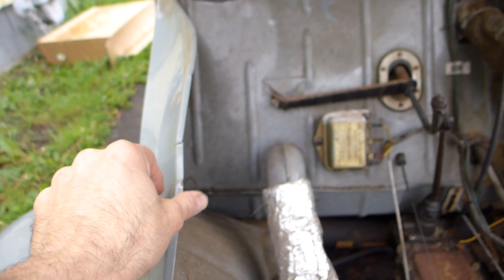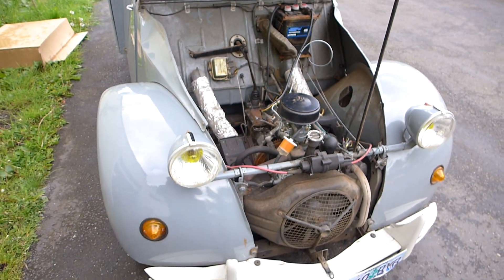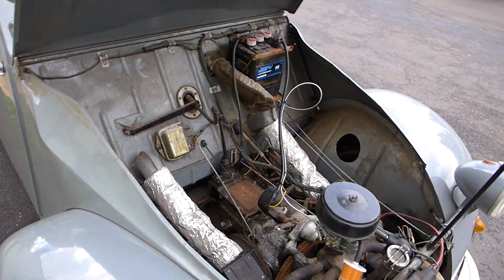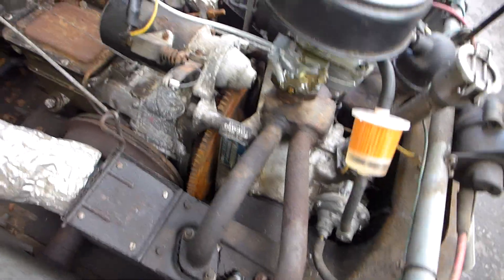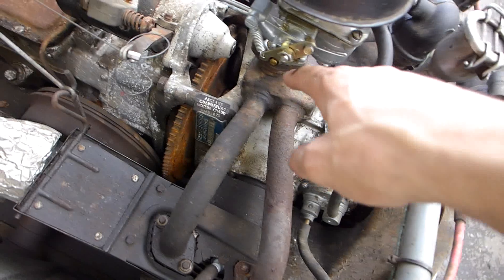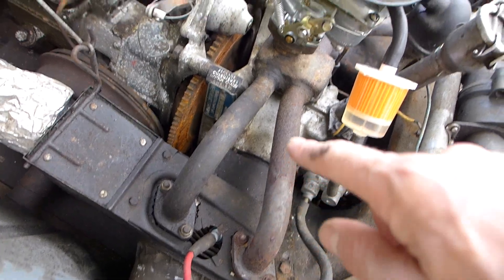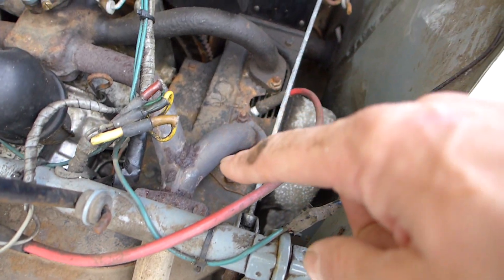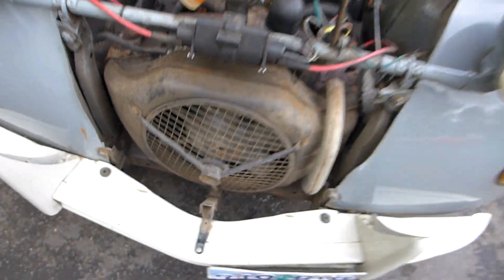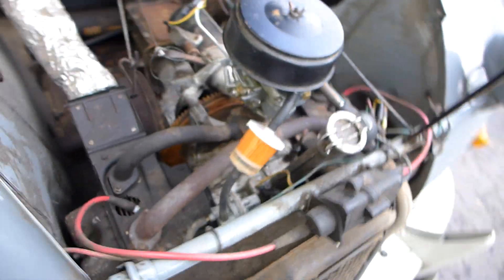As I was saying about the sheet metal on this car, it's all really light — very neat little truckette. It has a carrying capacity, I'm told, of 500 pounds — that's like two people. Looking at the engine here, it's funny: there's a single little tiny carburetor, this is the intake tube, this is the exhaust tube. The exhaust comes over and warms the bottom of the carburetor, merges with the other cylinder, and creates a pipe down. It's air-cooled of course, and if you look in there you could actually hand crank it — it's a very simple little car.